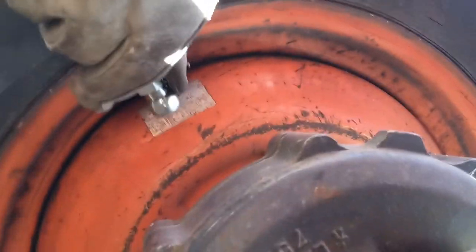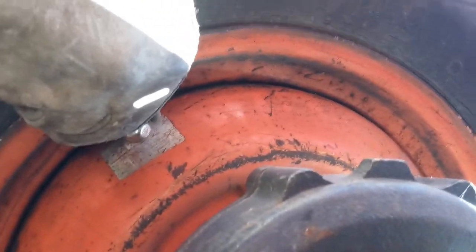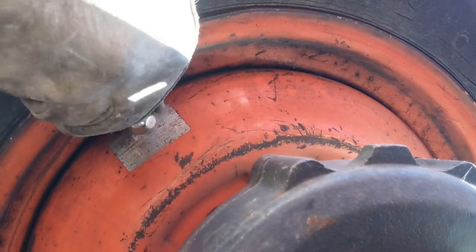It's important to think about things like that. The other thing is proper tire inflation. Because you're going to be putting a lot of weight on the tires, you want to make sure they're inflated properly with enough pressure to handle that weight. Otherwise it's really squishy, and if it's squishy like that you can actually end up in a rollover situation. As you can tell, I've got these tires turned around so that the wheelbase is actually wider.